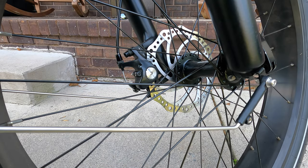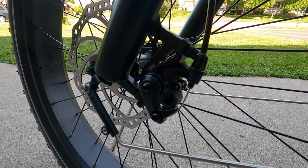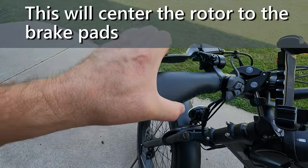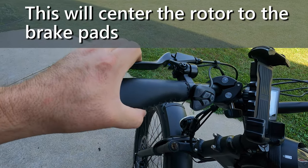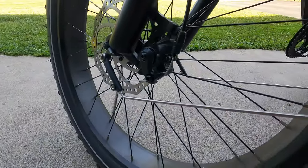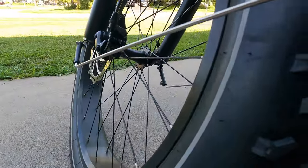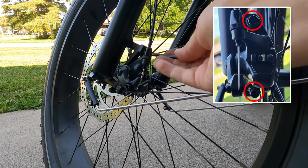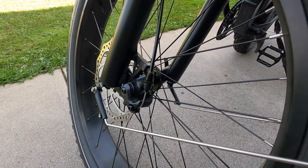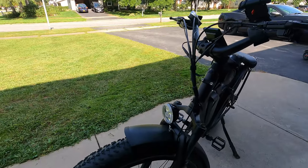The next thing we're going to do is pull down on the handbrake and then tighten up these two bolts. By holding the brake at the same time as we're tightening them up, that's what's going to adjust and center the brakes for us. Because we're doing the front brake and I'm close to the tire, I can actually reach both — I can hold down on the brake and come down here to tighten up these bolts. I'll tighten them down a little bit tighter now.